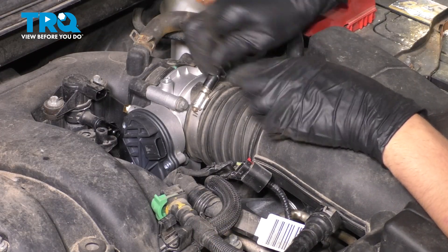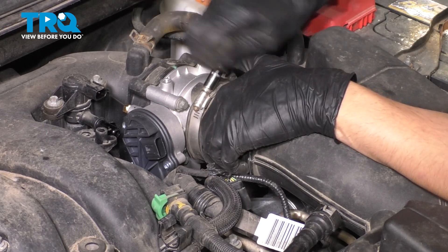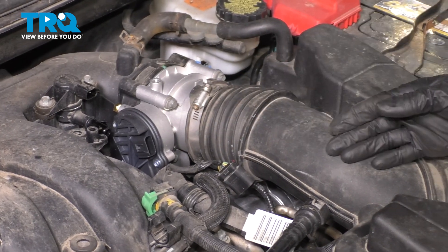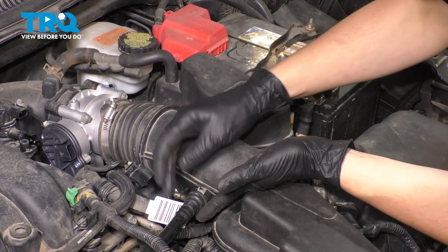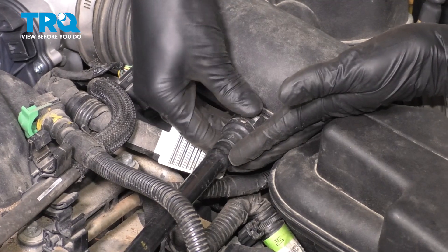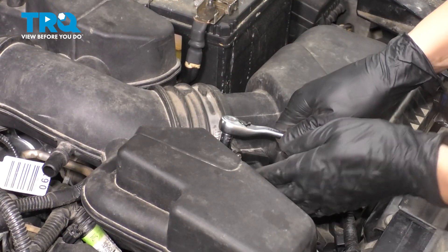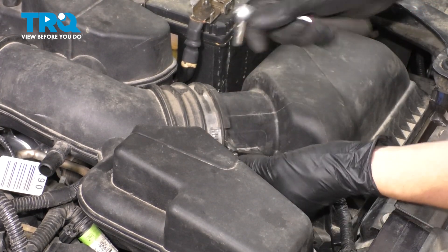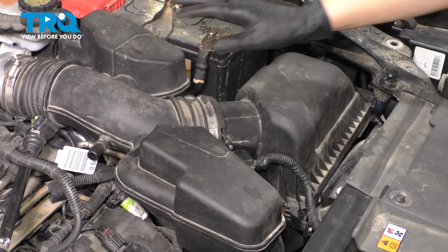Press on the connector and slide it off. Now release the clamp that holds this intake tubing onto the throttle body — make sure it moves; if you can't pull it off it probably needs to be unthreaded a little more. Follow the intake further and you'll see the PCV hose connected to it. Move this clip back and forward to hold it in the unlocked position so you can pull it off. Right over here there's another clamp — 8mm socket — loosen it up and unthread the bolt, which should allow you to pull this assembly out of the way.